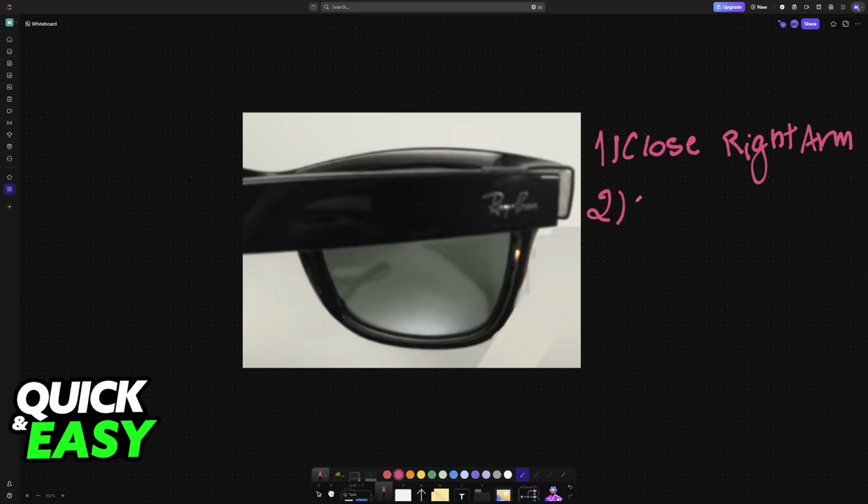to record 5 times. So press the capture button 5 times. You don't have to do this in quick succession, but just don't be too slow. So press this button 5 times. When you press this button 5 times, you will see that the LED will turn orange.